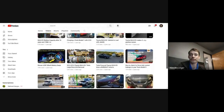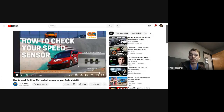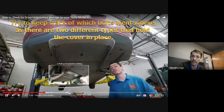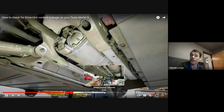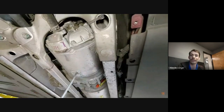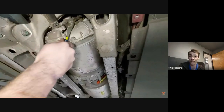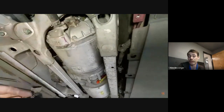Oh yeah, for sure. We actually have 3 different videos for it. We show it on 3 different cars: the Model S, the RAV4, and the Mercedes B-Class. But yeah, it's pretty simple. It's just one 10mm bolt and an electrical connector, which of course, if you're dealing with a drive unit that's already out of a car, all you've got to do is pull that one 10mm bolt, pull the sensor out, and look at it. Of course, if you're buying a used drive unit, that's not to say that an unscrupulous seller couldn't clean the speed sensor off so you won't see anything on it. But that is the best way to check to see if there's any coolant intrusion.